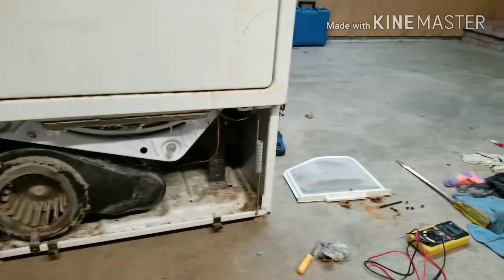When I first turned it on it would just hum a little bit, like something was stuck in the fan housing. I pulled it down to the fan housing and there was nothing. A lot of times people leave the filter out and it will suck a sock or something up into it and it gets stuck in the fan housing.